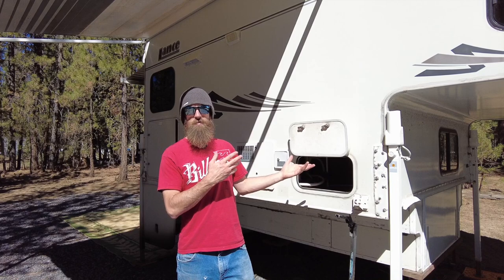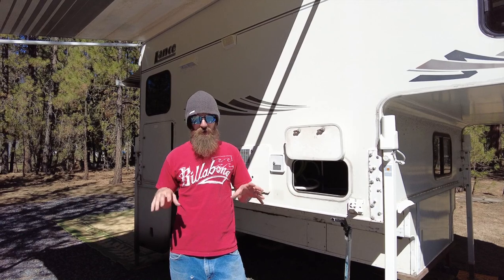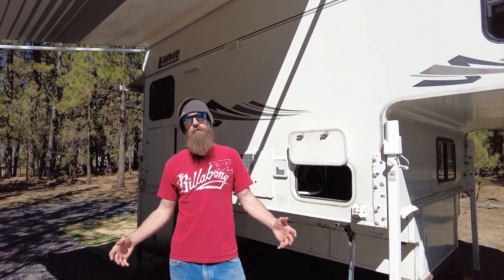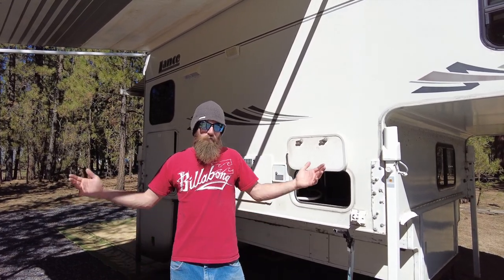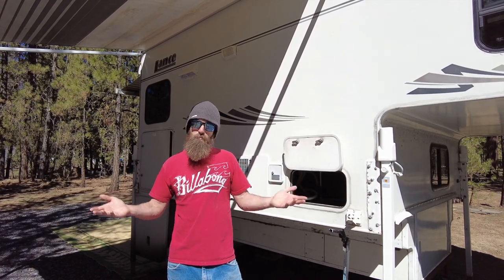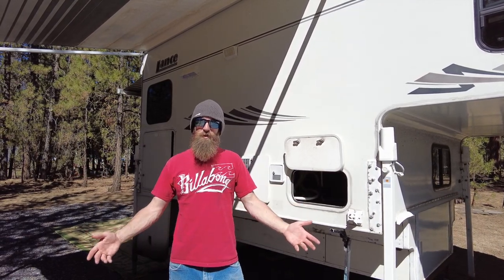We are actually going to be living in our camper throughout the winter, so we don't necessarily need to winterize it. It'll do just fine because it's a four seasons camper. As long as I keep the heater set to 50 degrees Fahrenheit or higher, nothing will freeze. The heater is ducted through all the pipes and puts heat on the water tank, gray tank, black tank, and all the pipes. But we know a lot of you are getting ready to winterize your RVs, so we're going to walk you through the process.